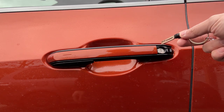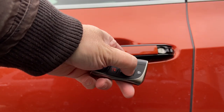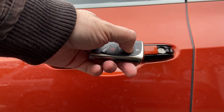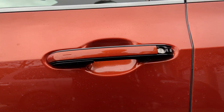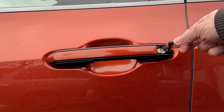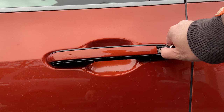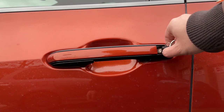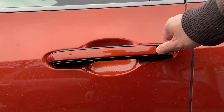In order to unlock it, even if I press unlock on my key fob, it doesn't do anything. Because you've locked it with the mechanical key, you have to unlock it with the mechanical key. You do the same thing but rotate it clockwise — one turn unlocks the driver door, two turns unlocks all doors.